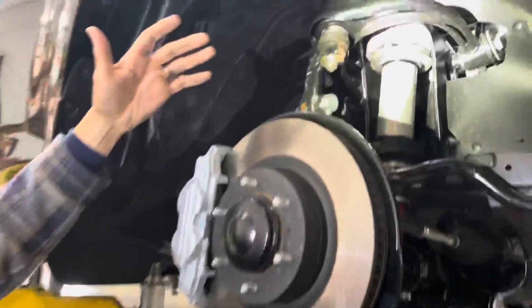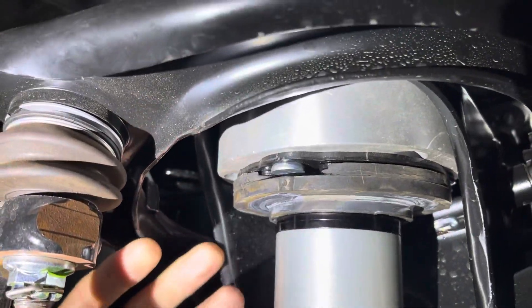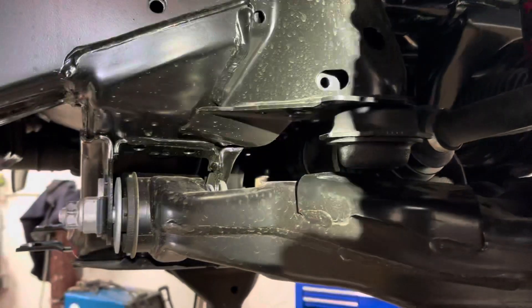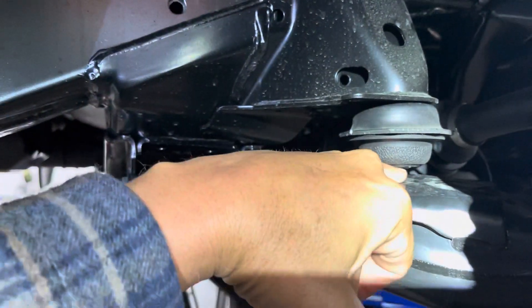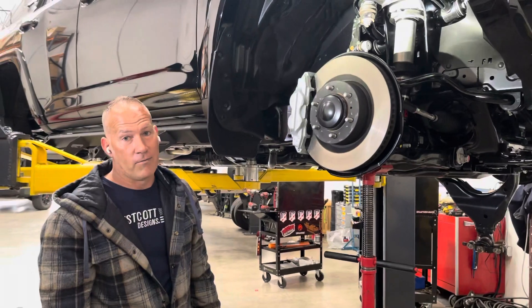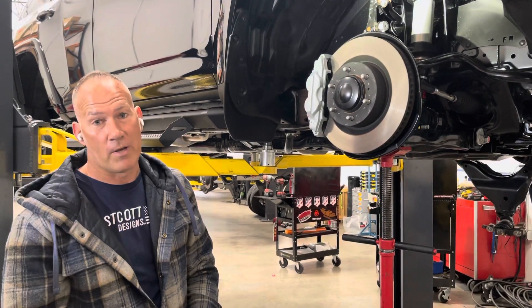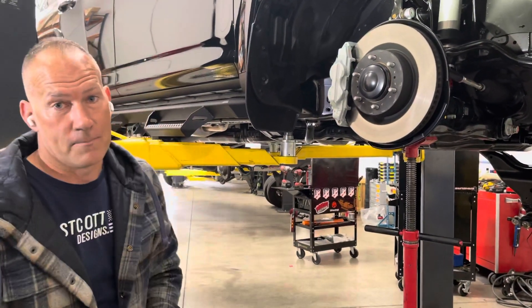It's clear as day that you can see what's going on here, and the bump stop is not being utilized. There is a gap here — I can actually stick my finger between there — and you can see it's not even bumped out on the control arm like it was designed. This strut is not designed to hold that kind of weight of the vehicle. Thank you for watching our video, and we hope you enjoy what we have to share with you on some of these suspension setups.